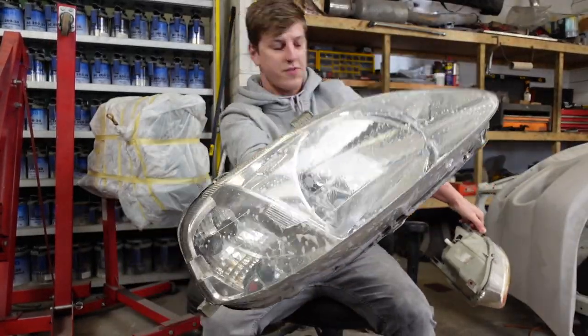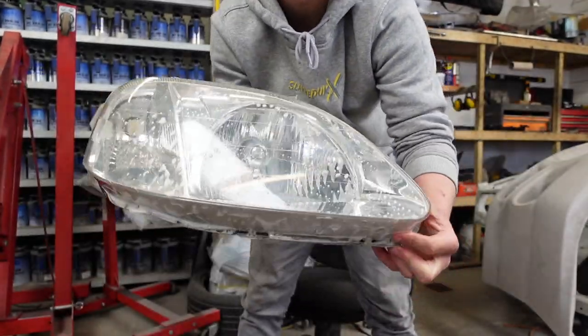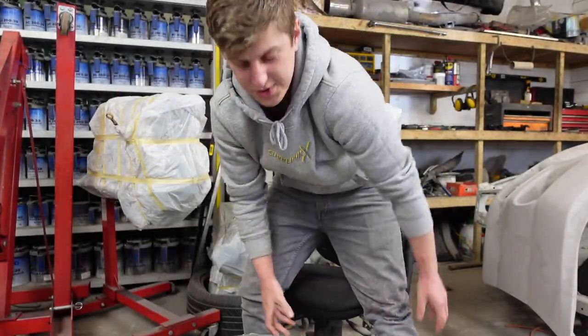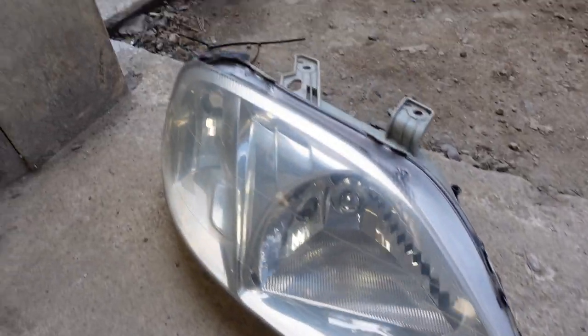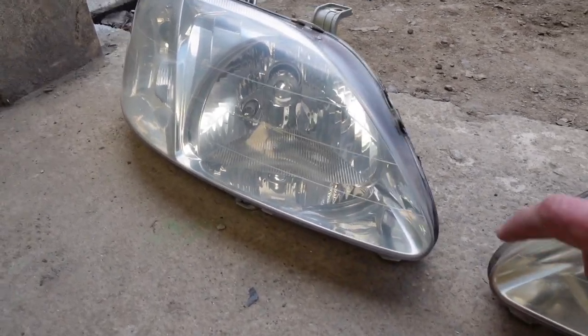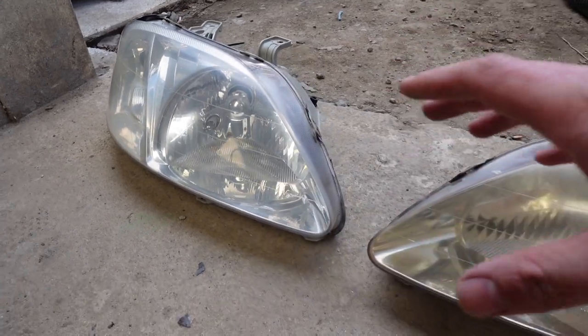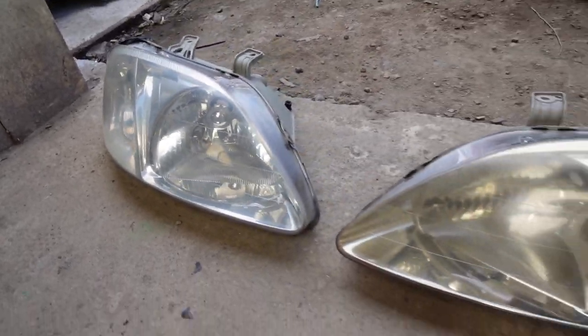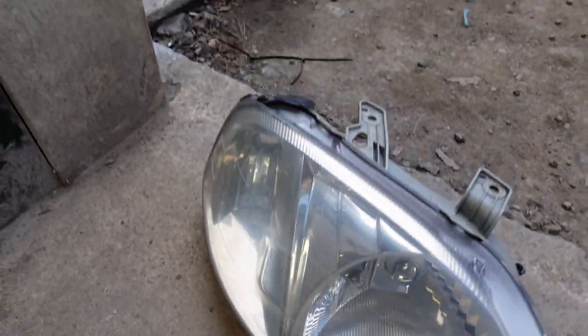So that's just with 3000 Trizact. Looks so much better already. Next step, polish. So this is where we're at now. This is 800 grit, 1500 grit, 3000 Trizact, all wet flatted. Next stage is polish. Going to be using some extreme cut raw with a machine polisher on the old fluffy pad. See where it comes out.